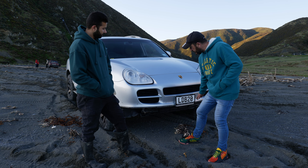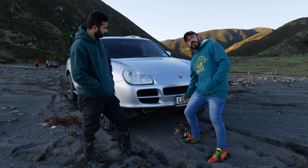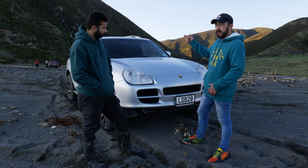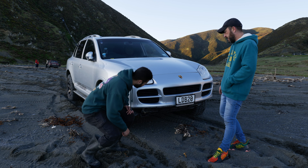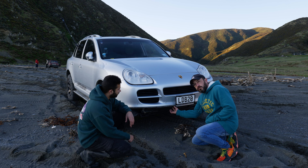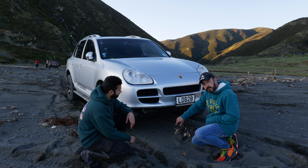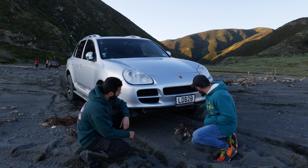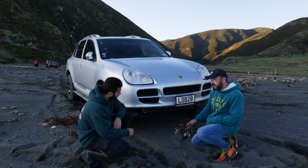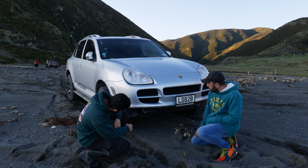The bar work that I designed is probably going to be on the car in the next month or so. It's a bar running down the bottom with recovery points, four rally lights, a nudge bar, and a tow hitch receiver at the front where you can install a detachable winch to either the front or the back to help with recoveries. It's two tubes running around the bottom of the vehicle welded on top of each other with fancy bracketry, attaching to the OEM recovery points. Same setup out the back — just a bolt-on solution for helping with recoveries.